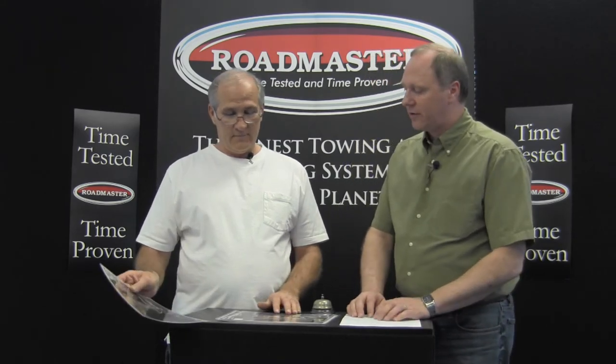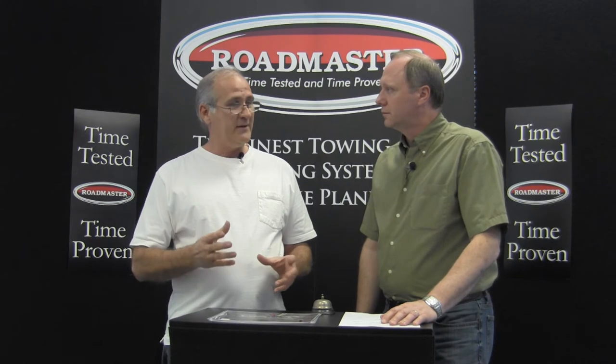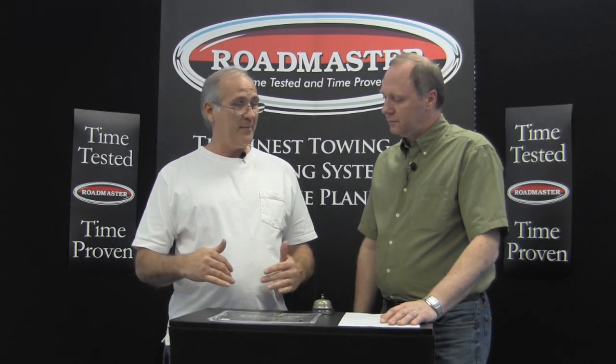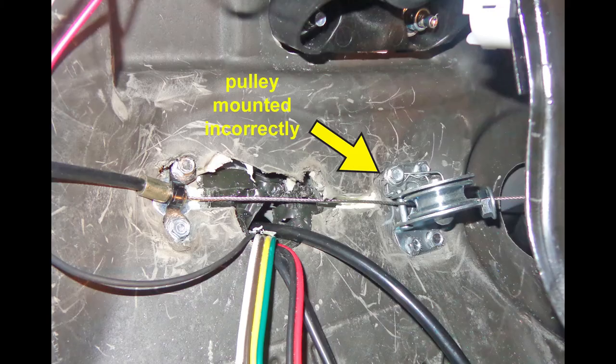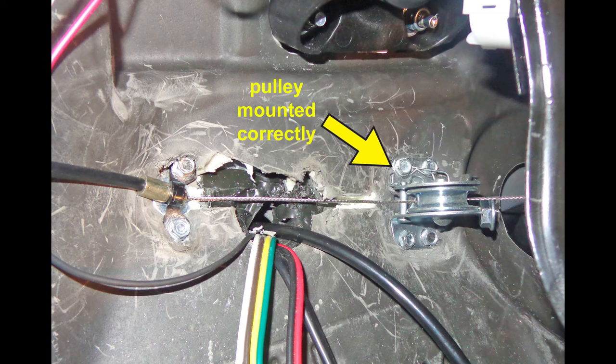Third item: the cable doesn't line up with the center of the pulley. The brake pedal, the firewall, and the way we route the cable are very important — not all cars are created equal. We find that oftentimes an installer will get in a hurry and won't take the time to get the cable straight off of the pedal to the pulley and to the cable anchor. When you have the cable on the pulley crooked, it can certainly jump off. You can see in this photo that this cable is very crooked — and this isn't the most extreme we've seen. This pulley should be straightened out so it's parallel and in line with the cable.